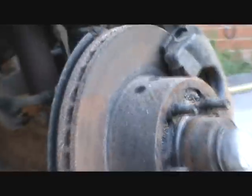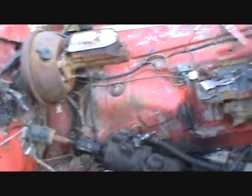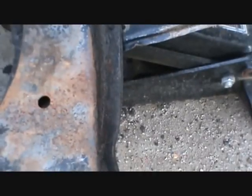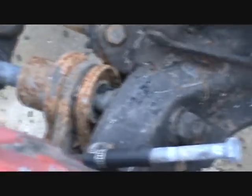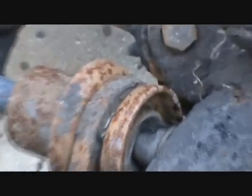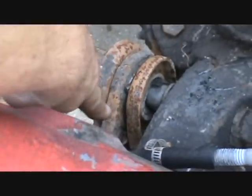Clean that cavity out and then you can start getting the torsion bars pushed back — it's not real easy, but I'll show you the highlights. I'm going to start by taking the steering box out, and I'm probably going to take this whole K-member out because this one's got a dent in it and I've got another one. There's the end of the torsion bar right there — you can see the bushing and what kind of shape it's in. That's the lower control arm bushing, and that's your adjuster blade right here.